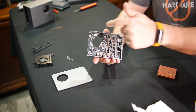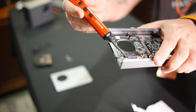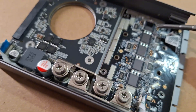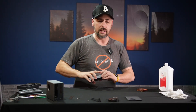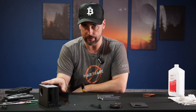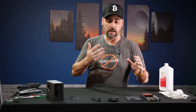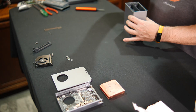We can take this and tear it down a little bit further. The control board comes out — you just take off the bus bars, or really just two of the bus bars. These standoffs, which were where the fan was screwed down into, come out and hold that board onto the card chassis. There's another screw right here that does the same. But let's look at the ASIC chips themselves. There are five ASIC chips on each of these cards, at least on the DG card — I haven't taken apart the AE card yet. The board that the ASIC chips are on actually has adhesive on it and is glued down to the card's chassis, so that's really as far down as I'm going to disassemble the card.